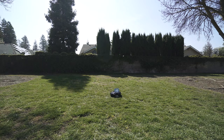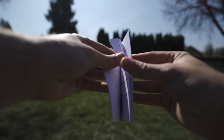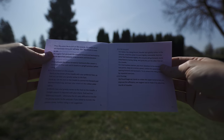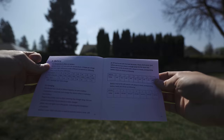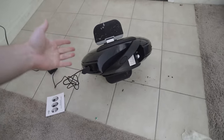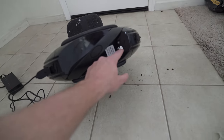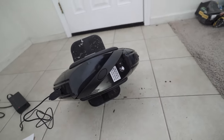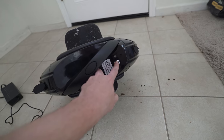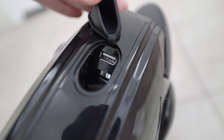It's completely dead — it had a full battery when I started. I'm going to look in the owner's manual to see what it says about clunking and stopping. They did include some extra fuses, so it probably just blew a fuse. I took it home — it charges fine but still won't turn on. I'm really suspecting it's a blown fuse. They include two 30-amp fuses, but it's charging and still not turning back on.